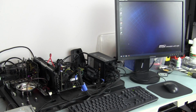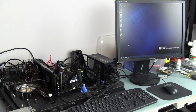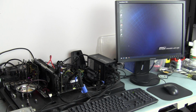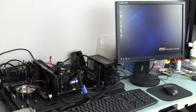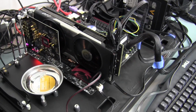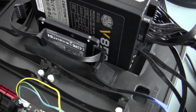Alright, so on the test bench we completed the checkout of the main components: power supply, SSD, motherboard, RAM, GPU, and the Sound Blaster. I actually have Windows 8.1 loaded on the SSD, and all of the drivers, and the drivers for the GTX 780, as well as the Sound Blaster SB 1500. So now that we know we have no DOAs and no problems with the hardware, next up really is to start breaking this down and mounting the water blocks on the GPU and on the CPU and get it mounted into the case. So the next video build log will be of mounting of those pieces into the case and getting ready to lay out the tubing run once we have the radiators fit in there.